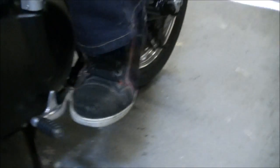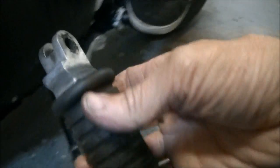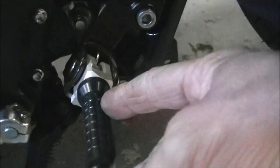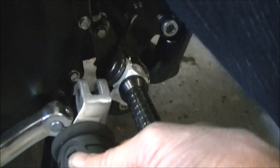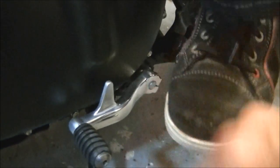Now there is a point here I just want to mention. You can see the kind of swan neck on the old peg — this kind of one-inch offset. And when you look at the new ones, they're not offset at all — they're completely straight. So the old one would have positioned the peg forward by about that much, and this one doesn't. So what it means is these are probably three quarters of an inch further aft along the bike.